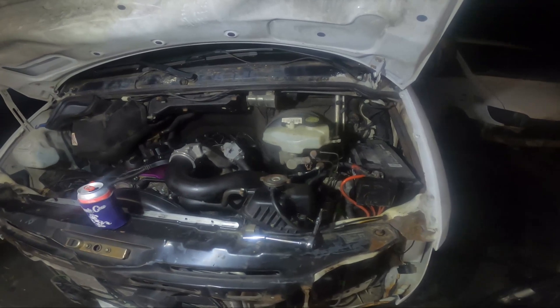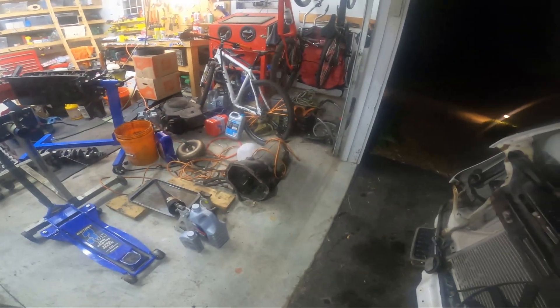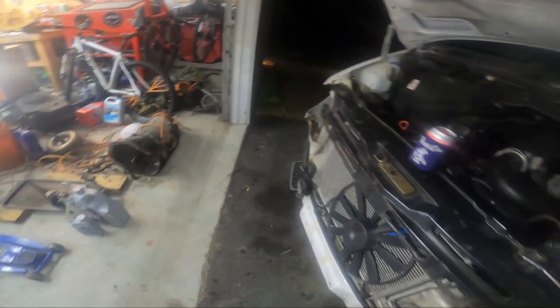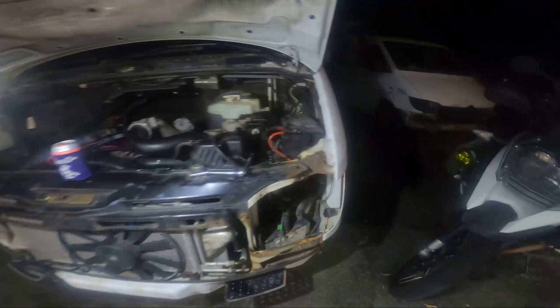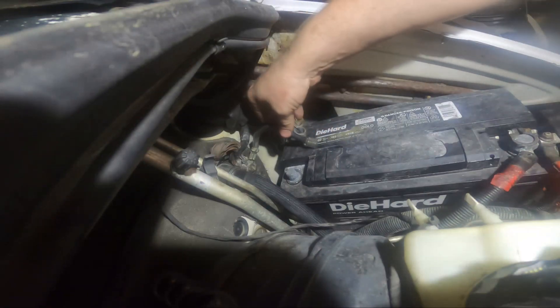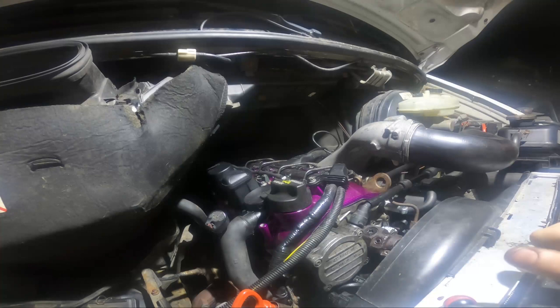I double-checked my checklist. I've got engine oil, I've got transmission fluid — it only took two quarts so I think I didn't drain it. There's fluid on the dipstick, checked twice, so we're good. Hooked the positive up, didn't hook the negative up yet. Horn is unplugged — good. There was so much water in the steering wheel it was honking on its own when my friend Jeff borrowed it. Touched the battery and didn't freak out. Little sparks — that's normal. Nothing caught on fire. The front fan is on all the time and I don't know why, and something over here clicks. I cleared all the codes and I'm going to try to start it — fuel's primed enough, we'll just see what happens.